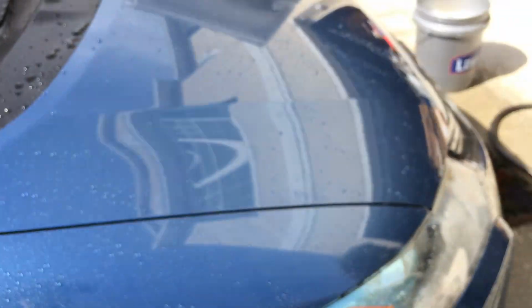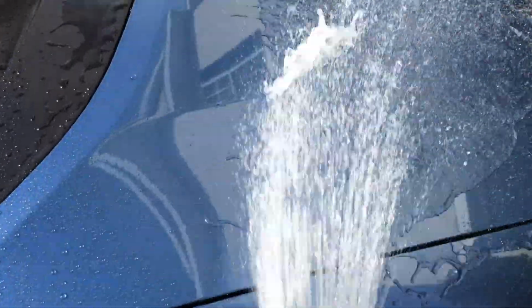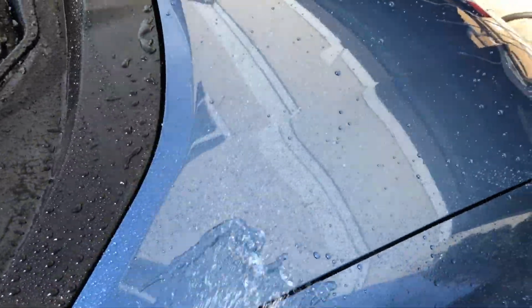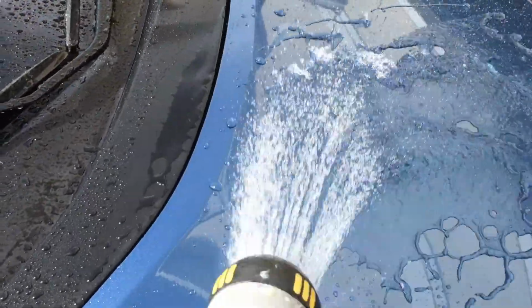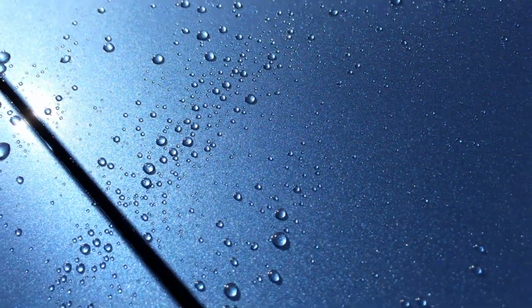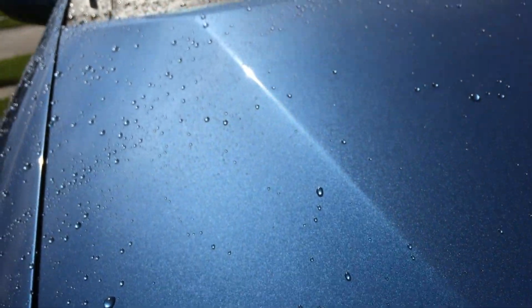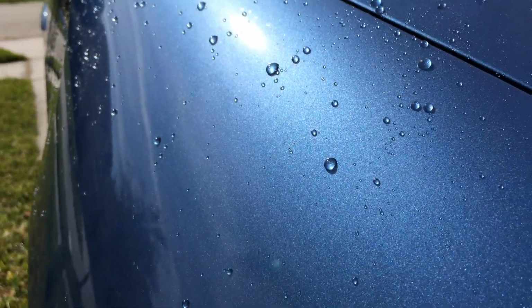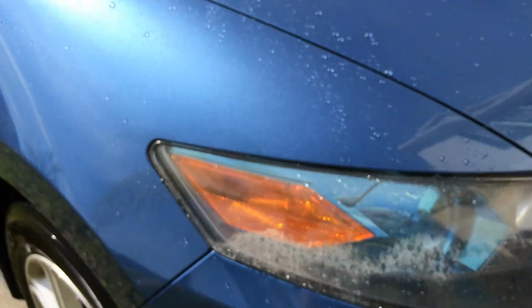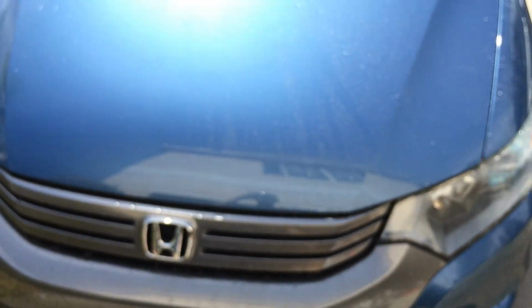And that water coming out of your sprinkler system or your hose, these are your two main sources for hard water spotting. And when we bring rain into the mix, rain is a different form of water spotting. It's naturally soft water, so this type of spotting you're going to get is basically the dirt or the dust that's already sitting on the paint. When the rainwater forms those beads, it'll just reposition that dirt or dust into the beading, and so when those beads dry up, you have little lighter spotting. And unless you live in an area where you've got some seriously nasty rain, you're not going to get any sort of damaging spotting caused by rainwater.